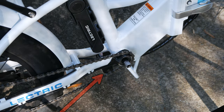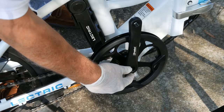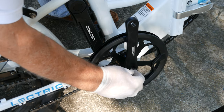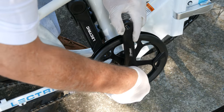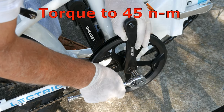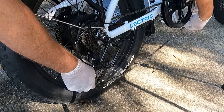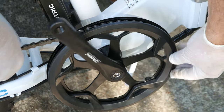As we prep for installation, note that the pedal on the opposite side is straight down, so we mount our new crank arm straight up and press it in place. For good measure, I tap it lightly a couple of times with a rubber mallet, so that the crank bolt with its thin threads doesn't have to do all of the work of pressing the assembly onto the shaft. The crank bolt slash dust cover is reapplied and tightened clockwise. The chain is mounted to the new crank assembly, and I give the arm a couple of spins to test the fit.